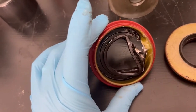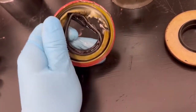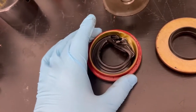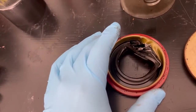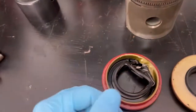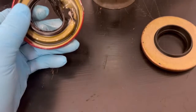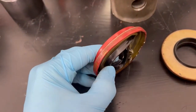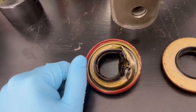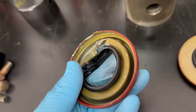So I tapped them in the best I could. I went through a bunch of these — I thought I had them in backwards at one point, pulled them out, reinstalled them, et cetera. Anyway, I got them in there and got the pinion put back on. They just didn't feel like they fit right. The pinion was feeling like it was dragging a little bit. I torqued everything down and did everything I was supposed to do. Then I pulled the pinion off and noticed it was rubbing against some of the rubber sticking out on these seals. Long story short, I said to myself these didn't look anything like the seals that actually came off the Jeep.